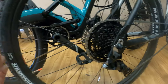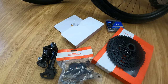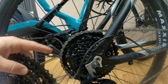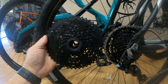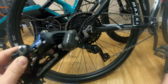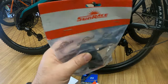The X01 weighs like 357 grams just for the cassette. We're going to weigh the Advent to see how it compares to the SunRace we're testing and also the Box components. This week we're going to install the SunRace M9 system — also a nine-speed, with a bigger outer cog at 46-tooth compared to the Advent's 42-tooth, so you have a little more range. We're going to install the M9 derailleur, which I believe is their new SunRace M9 nine-speed, and it has a clutch — or as they call it, a stabilizer.